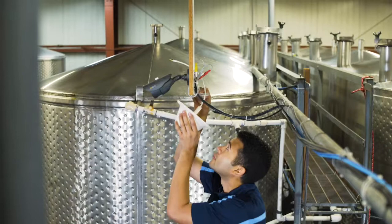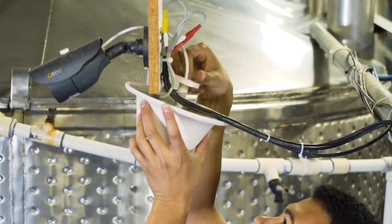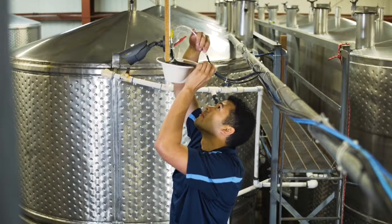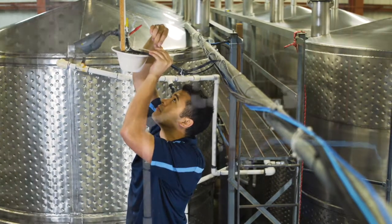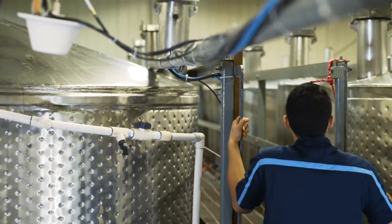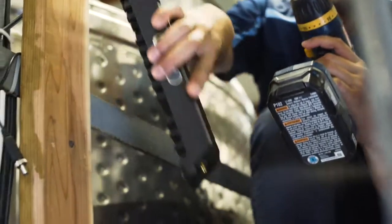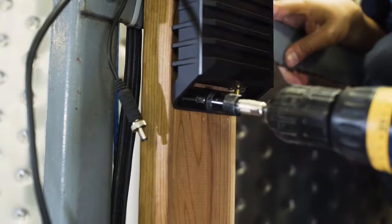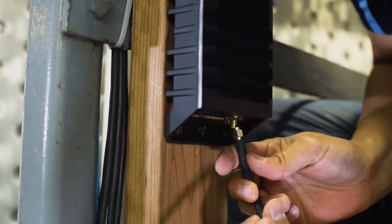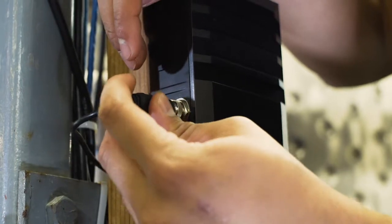Next, mount the server antenna in the planned location. If possible, you can use the mounting hardware supplied with the antenna. If needed, you can also use a CellFi antenna mounting bracket for the server antenna as well. Now you are ready to install the Go unit itself. When permanently installing the Go unit, make sure you carefully inspect for existing plumbing or electrical lines prior to drilling any holes. Carefully mount the CellFi Go and connect the antenna cables, making sure the antenna cables are snug. Then connect the power cable to the side of the Go unit and plug it in to an outlet.